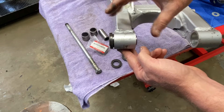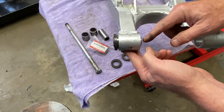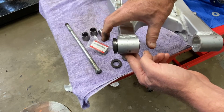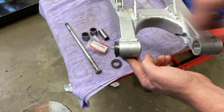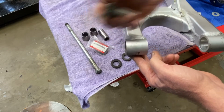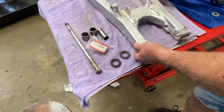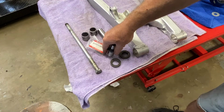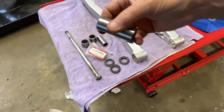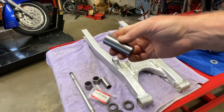And so the point here is we get our needle bearings pressed in. We can just slip these in and then press these guys on and squeeze them in, and then essentially have an assembly on each side of the head or the front of the swing arm. I have a couple of challenges though that I wanted to show you, and what my plans are for hopefully solving these, because I think I can make it better. $6 million man. We have the technology. We can make this swing arm better. I think we can. So let's go over that real quick.